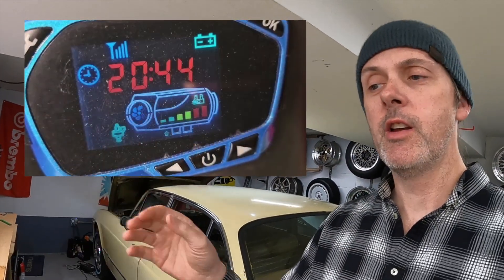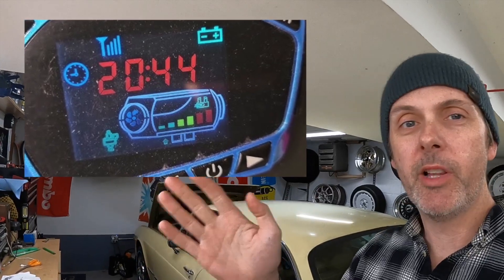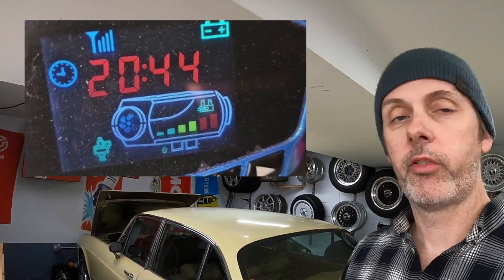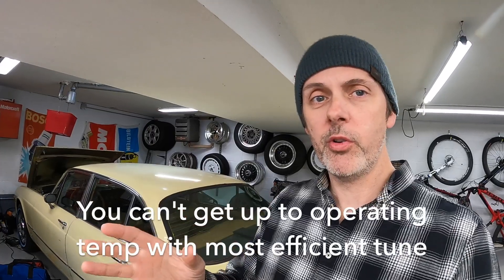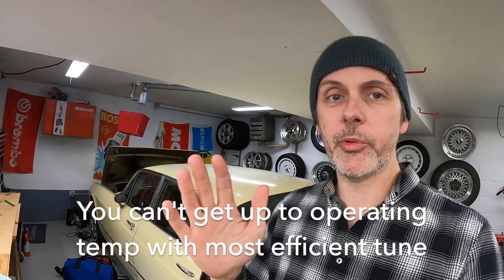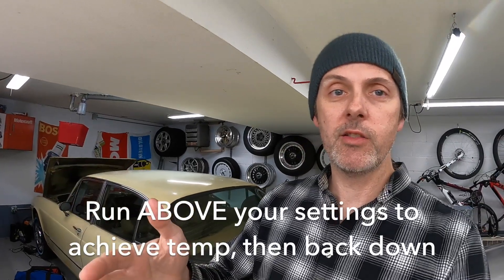One more thing — I actually had to adjust my heater one more time after everything we just went through. The reason wasn't that I needed it to run cleaner, it's that I needed it to run hotter. With settings of 1.0 to 2.0 or 2.3, I couldn't get my glow plug hot enough — the colored bars on screen I could only get to yellow, I couldn't get those last two lit up red to know it was running the way it should. So I adjusted that top end to around 2.6 to 2.7, but when it's cold enough outside you can't go from a cold diesel heater to the correct operating temperature with that optimum burn. You basically need to run it dirty for a minute, then once it's hot switch back into ultra efficient mode.